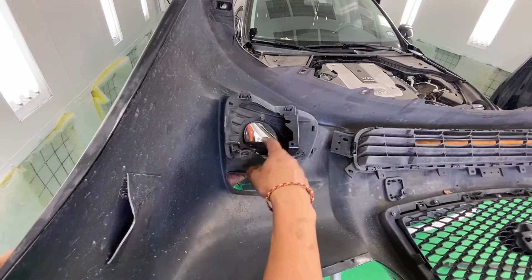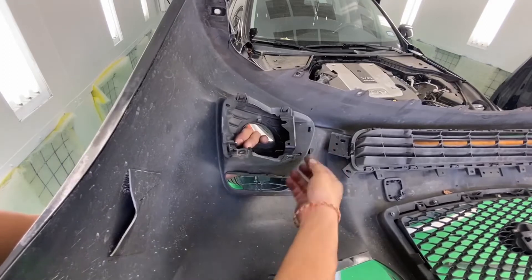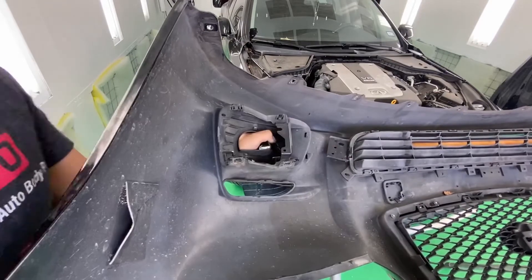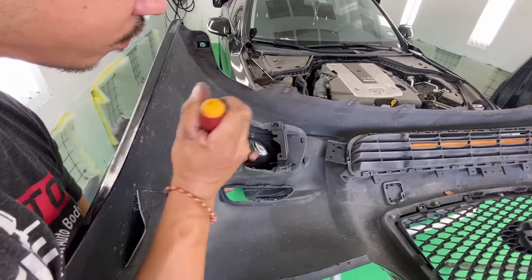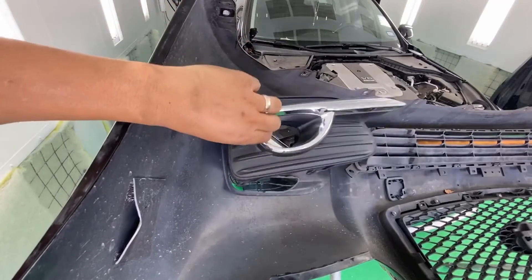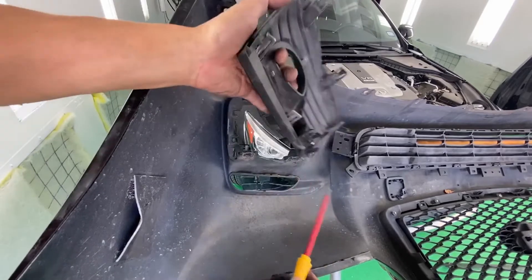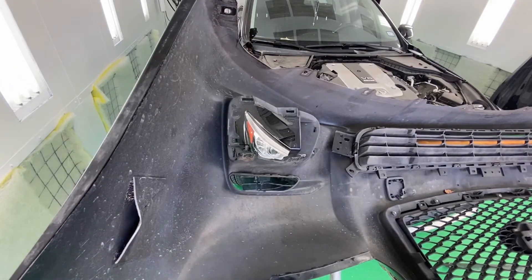On this conversion we don't need this fog light cover, so we're going to have to get a new one. But if you wanted to take this one off, just push down on these tabs. While pushing down on those tabs, you also need to pull on the fog light cover itself. Go ahead and repeat those steps on the other side.